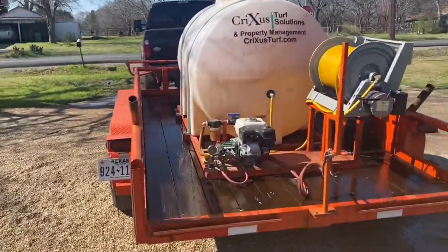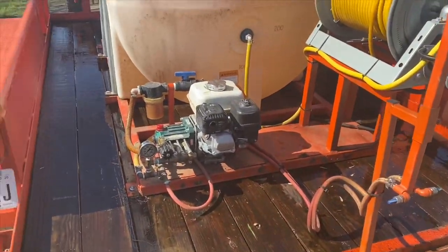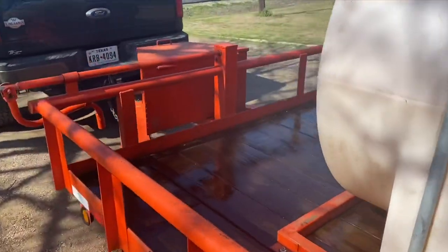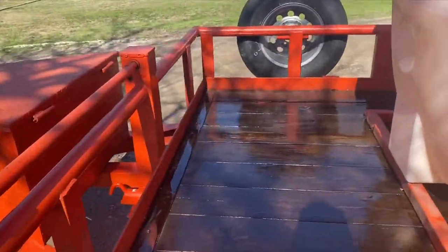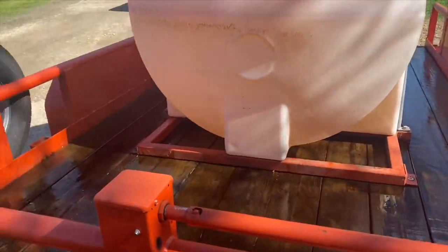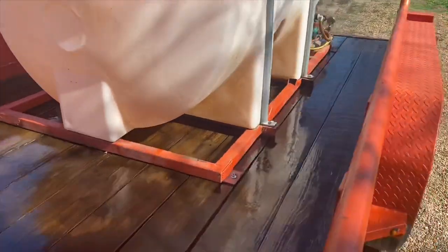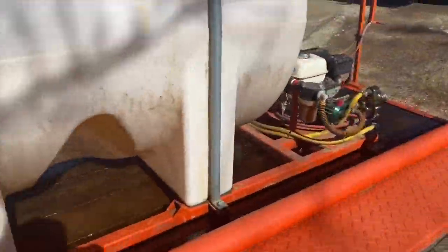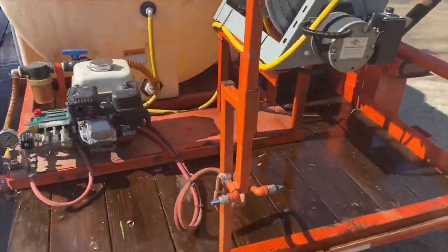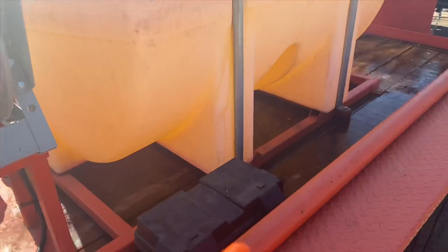This short video shows how to keep your trailer floor healthy. As you can see, it's real shiny — it's got oil all over it, motor oil. The rig wasn't on there; I just put the rig back on. I do this once a year, like a creosote treatment you could call it. I have this little flat brush, I pour the oil on the trailer and smear it around.